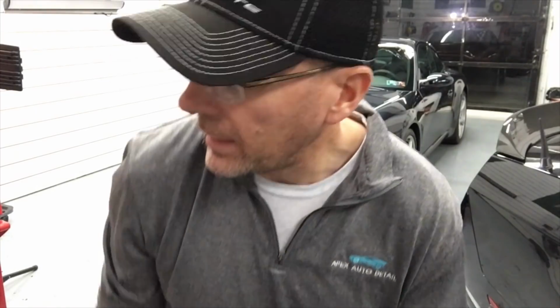And then also, something to keep in mind that a lot of people aren't aware of, ceramic coatings. It's not the SiO2 itself that produces the hydrophobic properties. It's some of the formula that is within. There are some ceramic coating kits that have a base and a topper. The base, if I put that on there and gave that back to you, it wouldn't bead incredibly well. It's the topper that produces the super hydrophobic properties to the coating. It's not the SiO2. And that said, if you take note of ceramic coatings that sheet, again, SiO2 isn't what makes it bead. It's some of the super hydrophobic properties they inject into the formula. And with some of those spray coatings, the protection will still be there. The SiO2 is still there. It's just some of that formula that has the hydrophobic properties may have worn back a bit.